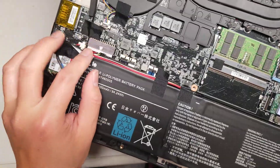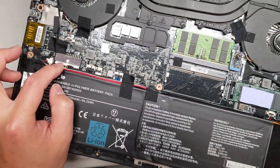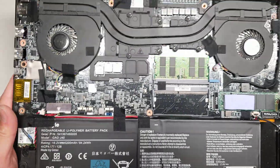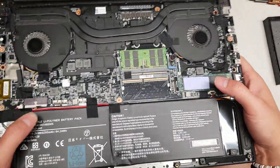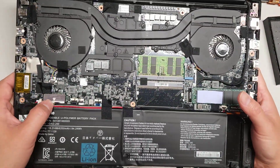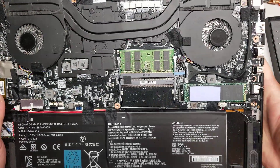Then there's the battery connector here. If you're going to mess with other stuff, you probably want to remove the battery first. Most of the time it won't be an issue unless you drop something metal or conductive and fry something. But to be safe, remove the battery and hold the power button for a few seconds — usually 30 seconds is good — to drain the power.